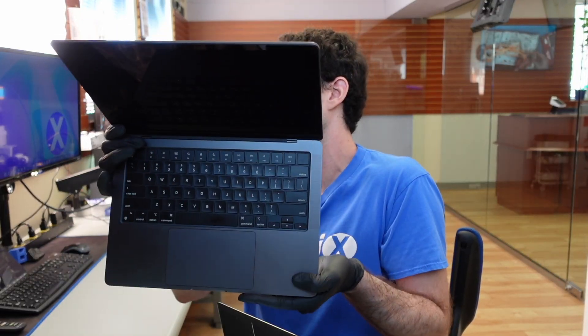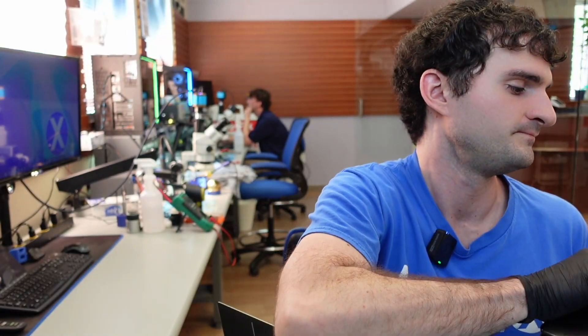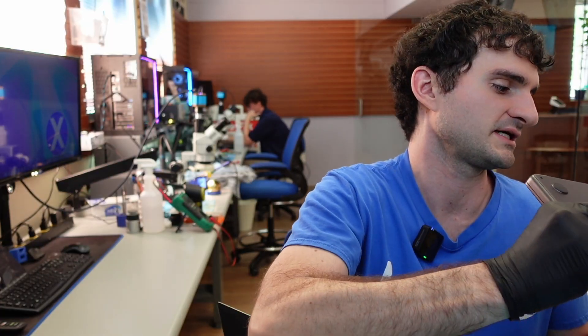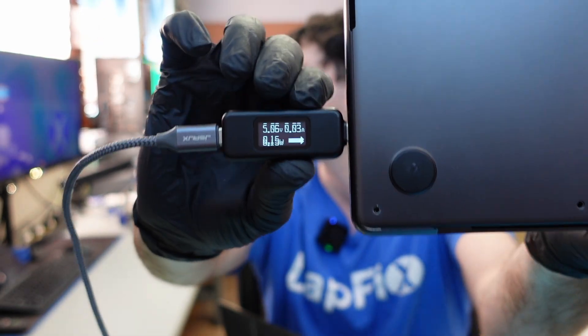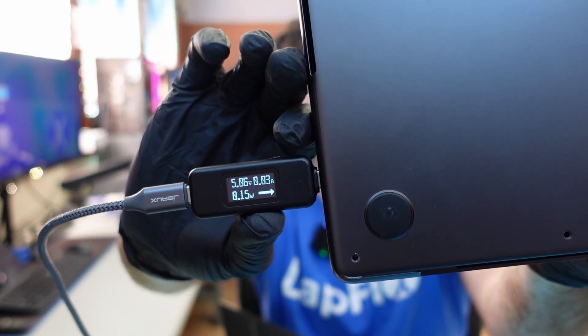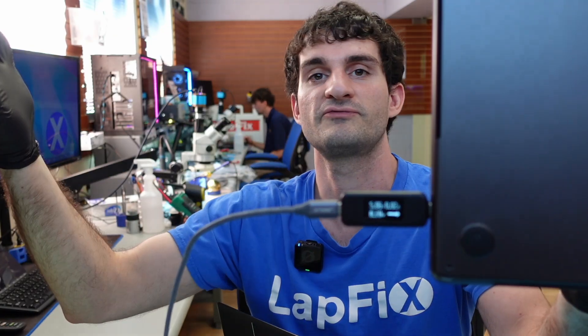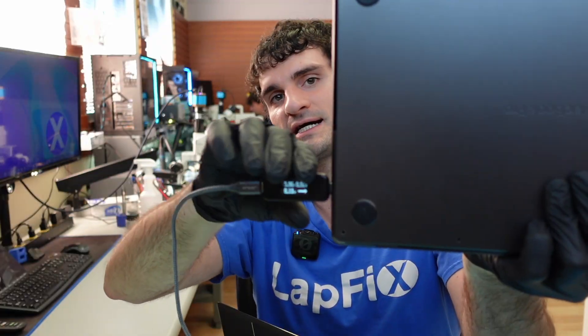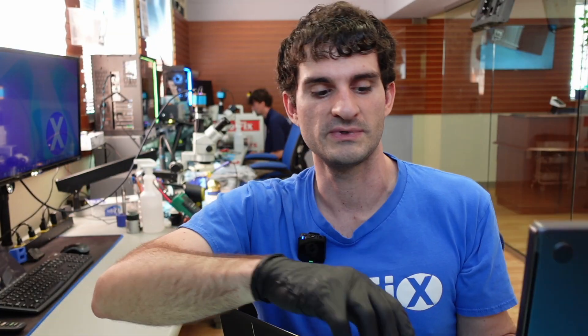We open it and we don't have any type of power. We have a USB-C tester that we can try, which is going to check how the MacBook is accepting voltage coming in. We're getting about 5 volts and a very low current, about 0.02 to 0.03 amps. We're looking for maybe 20 volts — because it's USB-C, it's converted inside. We plug in the next port and get the same reading. So we need to open it up and take a look inside.